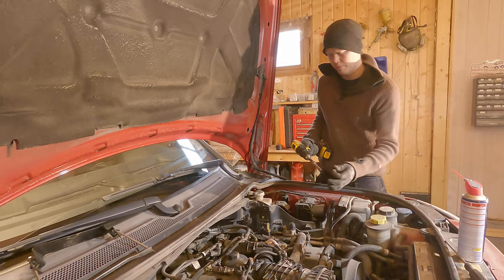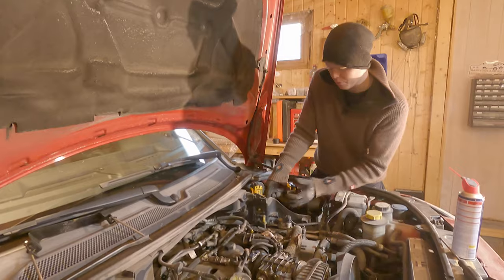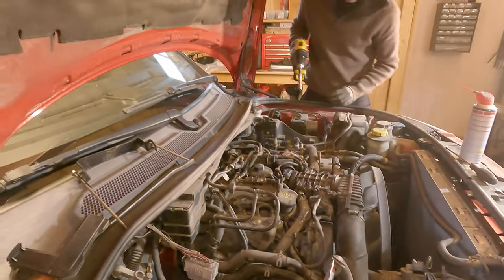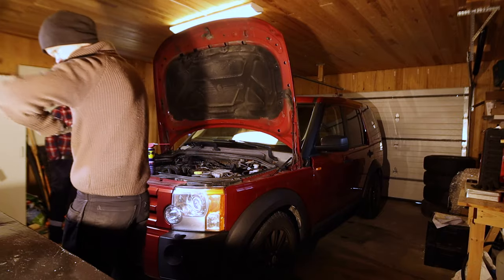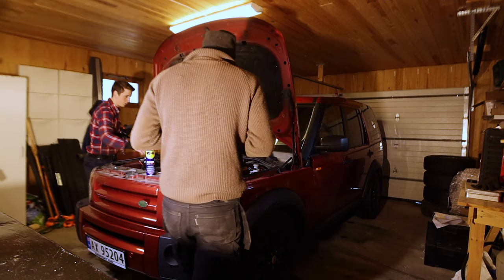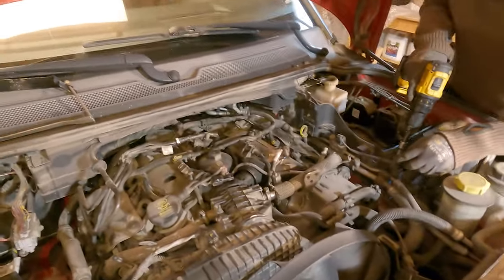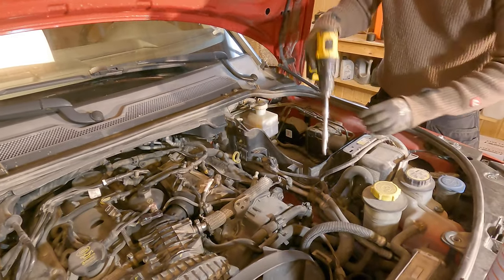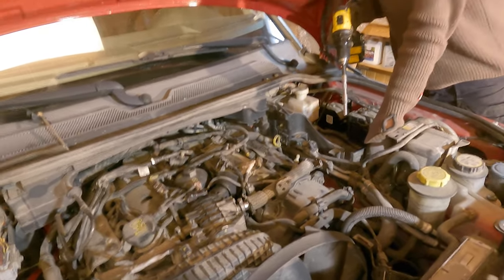But if you need to do something with the EGR anyway, if you blank, so. Okay. Why would you do that? I don't know. I opted to change out the EGR valves and not blank, to keep the car legal. Also when you blank, you have to remove the butterfly valve, and if the turbo fails and you get oil in and the engine starts running on oil, there's nothing to kill it.